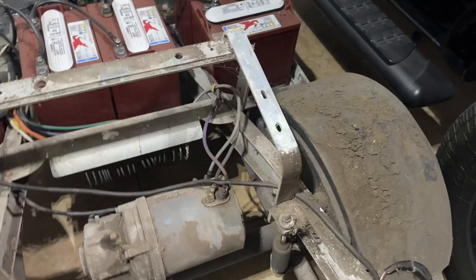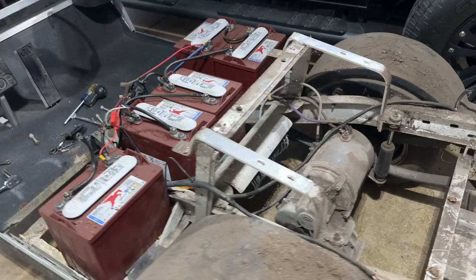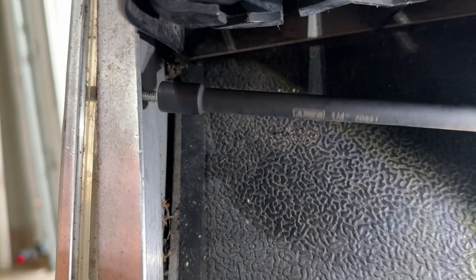So that's how you take the body off of a Club Car DS. I'm going to go ahead and do the front part and put it in this video. Next is taking off these quarter-inch little screws — there's one way up there, one down there on each side of this thing. What you're basically doing is freeing up this area of the body that's tethered to the frame here. These are little machine screws with a quarter-inch head on them and a flat head — there's really no point in having a flat head on there.